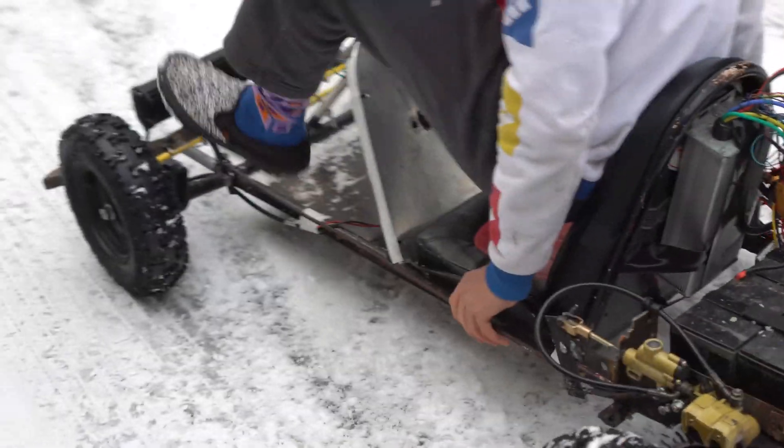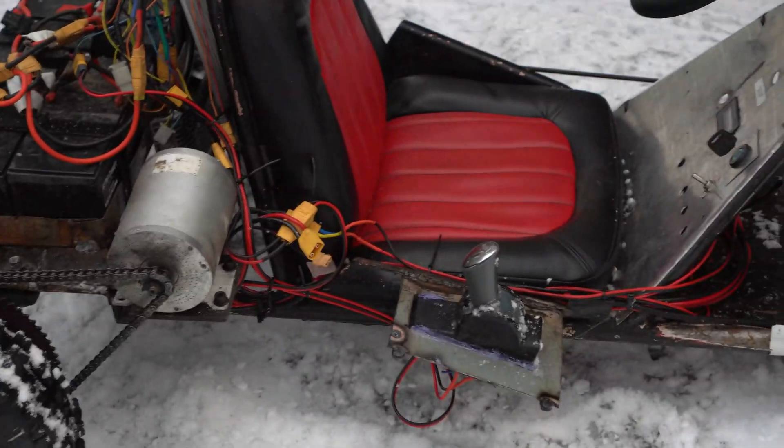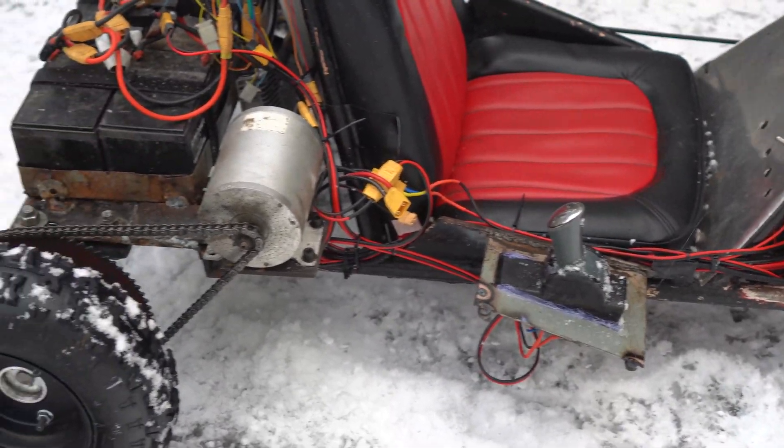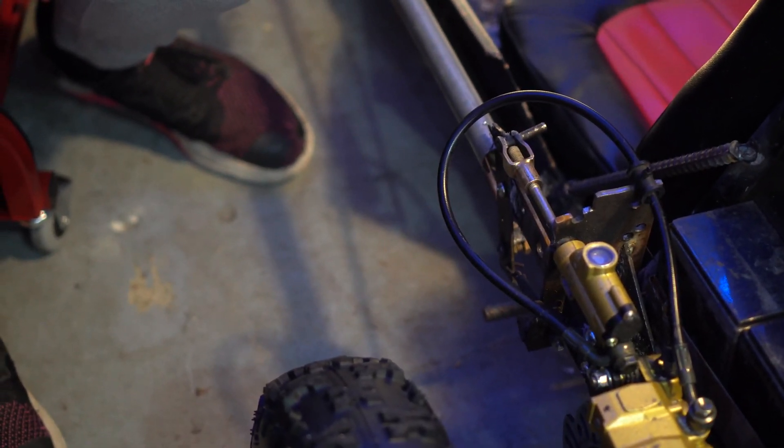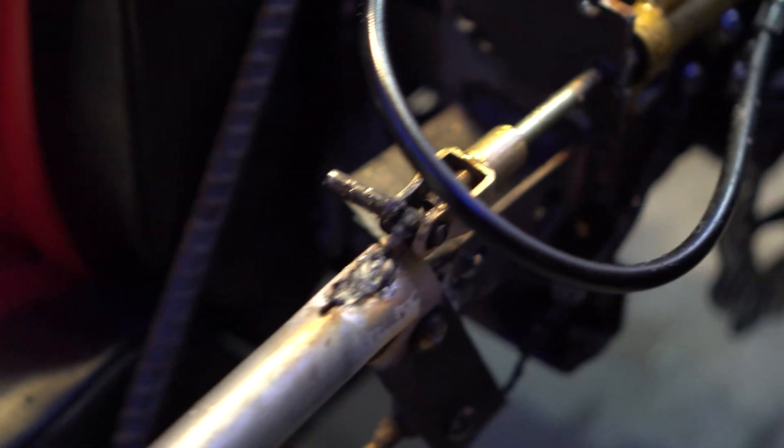All right, we're putting in a handbrake. Whoever's watching this — that was just decided — we're putting in a handbrake. We'll make it so that it's a much stronger thing, so you move it like an inch and it blocks the brake out. We've decided to build a handbrake with this, and I'm sliding it so we can put it on the brake line as it is, and we'll just weld it there, cut it about here. We might come up with a parking brake mechanism so you can just pull it up and it latches, to park on hills and stuff. We just finished welding on the handbrake as well as the support right there just to keep it straight, so there's not too much side-to-side movement in the pipe.